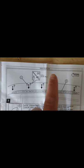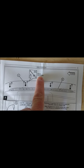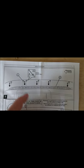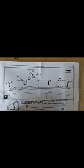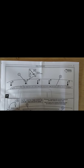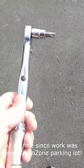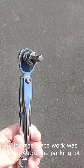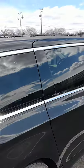Step seven requires a torque wrench with 3.6 foot-pounds of torque. I don't have a torque wrench and I also don't have the star bit, so I'm going to AutoZone to see if I can borrow those tools. I just went to my local AutoZone and they lent me the torque wrench with the correct bit, and I just got them all tightened down.